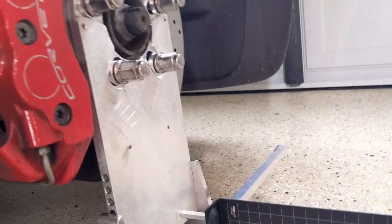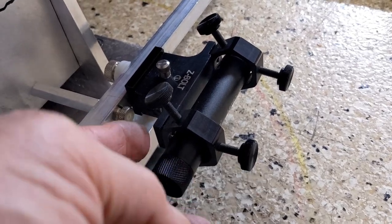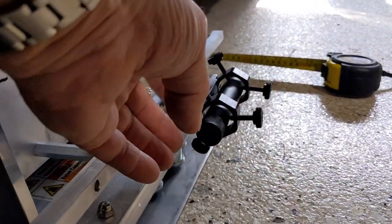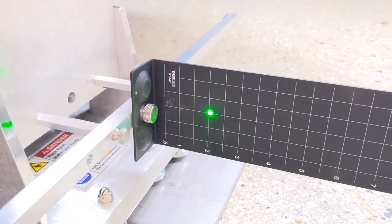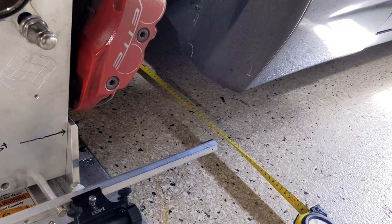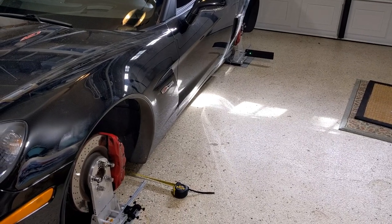What I'm doing is loosening one screw and tightening the opposite, moving the beam over a little tiny bit each time — that kicks the back of the laser one way while the front goes the other way. I'm dead on line two — that's calibrated. For the vertical, you can move the laser in its mount, but the critical one is the horizontal. Rinse and repeat for the other laser. Laser number two is calibrated.